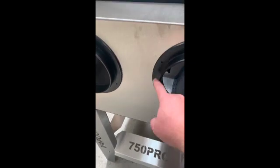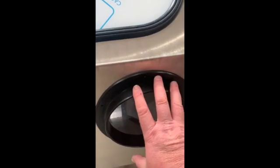The gauntlets use the longer rivets because of the thickness of the plastic attaching to the metalwork. You've got double-sided tape around the edge of the gauntlet in the kit. You've got two big gloves. Simple way of fitting them: take the coating off the double-sided tape, put the glove in making sure the fingers are level — you don't want to fit the glove at an angle. Pop the glove through and peel it around, sticking it to the tape. The tape just holds it in place until you can get the metal jubilee clip on. You've got two big jubilee clips in the kit.